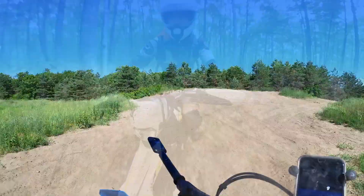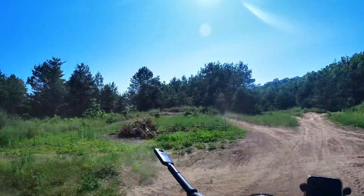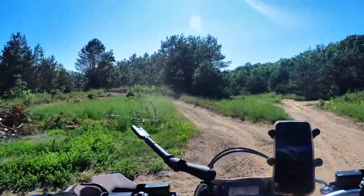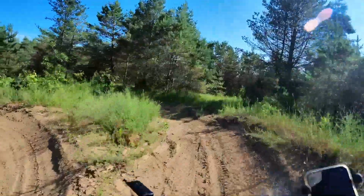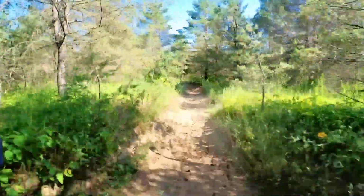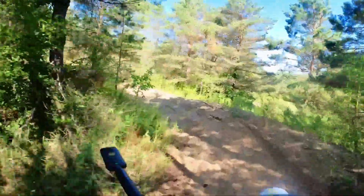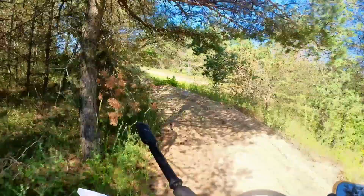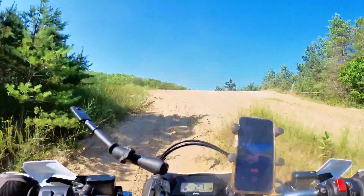Why this bike? Let's look at the facts and figures first. The Ultra B is smaller and lighter than most enduro-type bikes out there. It runs a 74-volt 55 amp-hour battery and puts out 12.5 kilowatts of power with 325 pound-feet of torque. That will sound weird to most riders of gasoline machines, as 12.5 kilowatts translates to 16.8 horsepower and the torque figure just sounds like fairy tales.